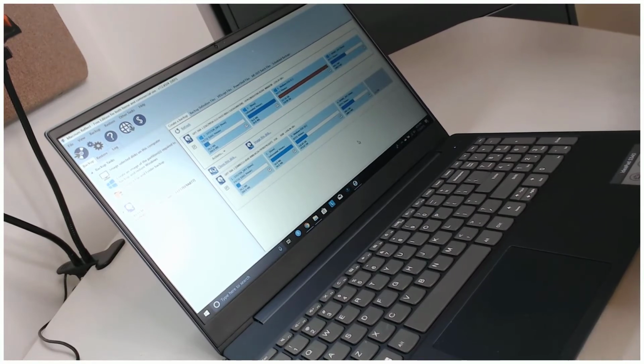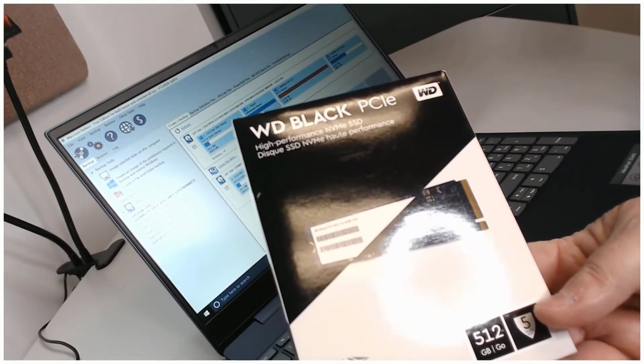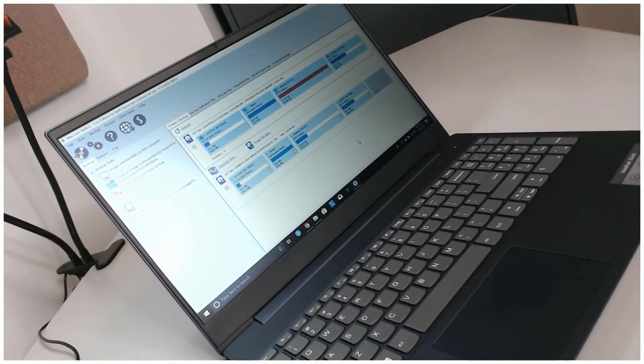Now, of these three upgrades, the one that I would probably lean towards recommending would be upgrading the SSD. I do agree that I was dealing with somewhat large files in the course of my classes over the past couple of weeks. But to be quite honest, if you or somebody you're buying this for is going to play games on it, they're going to run out of space on that 128 gig SSD. And yes, you can say that certainly they could supplement that with a hard drive, just boot off the SSD and then load the game files themselves on the hard drive. But they're still going to be happier if they put the SSD in. You don't need a 2 terabyte SSD. It's going to be prohibitively expensive. But these 500 gig SSDs have really come down in price, so I think that's the way to go.